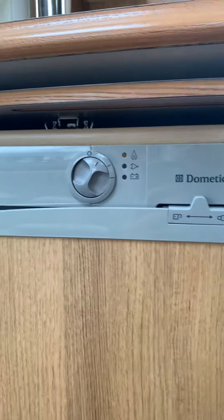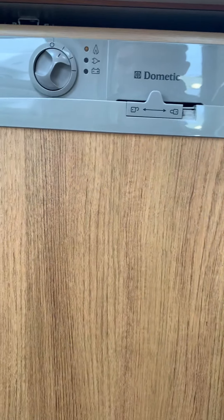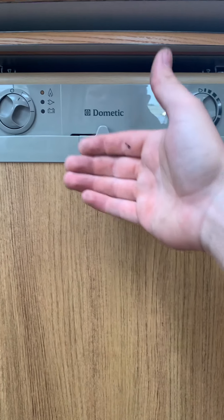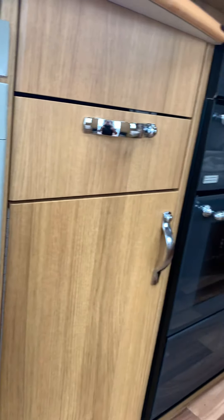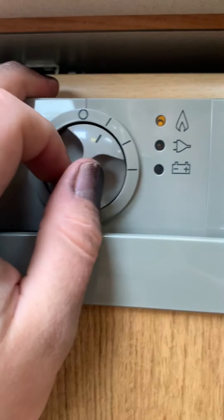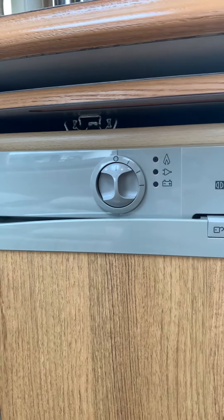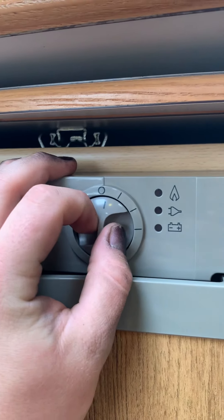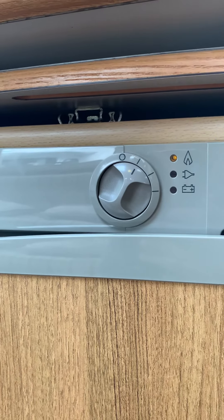I'll show you the fridge next. I've got the fridge lit on gas at the moment, and I know that because there's a little amber light inside there and it's not flashing, I also can't hear the igniter, and there's hot air at the back of the vent on the top right hand side. There are all different ways of knowing the fridge is definitely lit up. To actually light the fridge up on gas — which is probably the most efficient way — you just do this and push it to the right. You hear the igniter spark, you hear it light up, and then you hear it stop. That's just it lit.